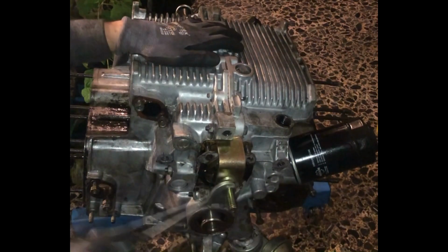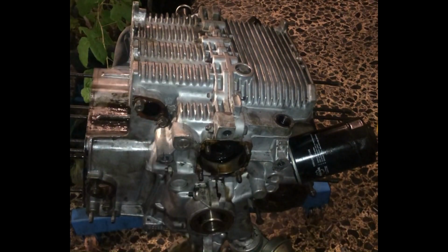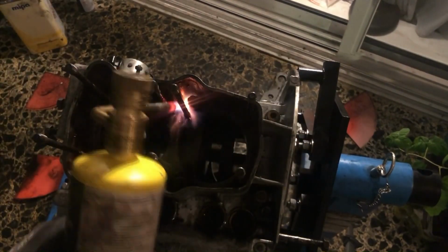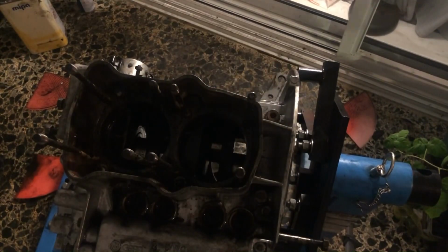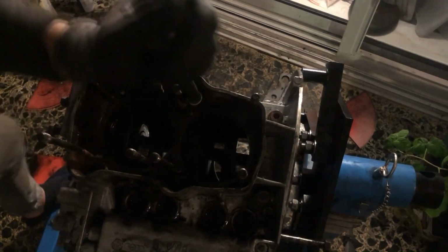What we will do now is heat the special nuts inside the water jacket up in order to break corrosion and keep something from snapping, and it also makes your life a little bit easier. And take our breaker bar in order to loosen them. What I also did, but I didn't film, is remove all the surrounding nuts. I didn't film it because it would take a lot of time and it's pretty much nonsense to film it.